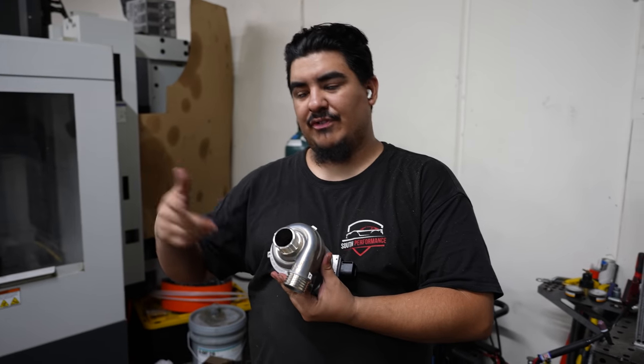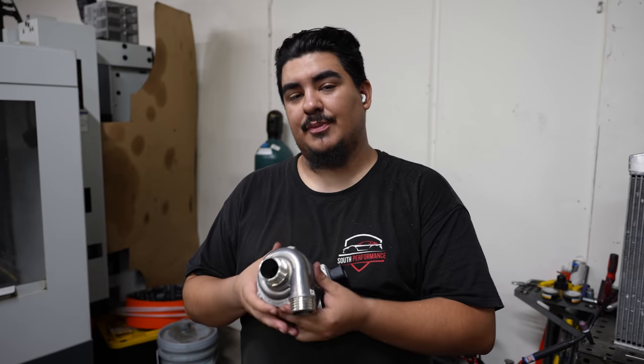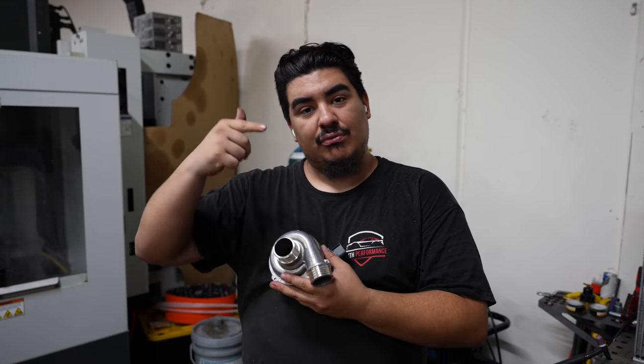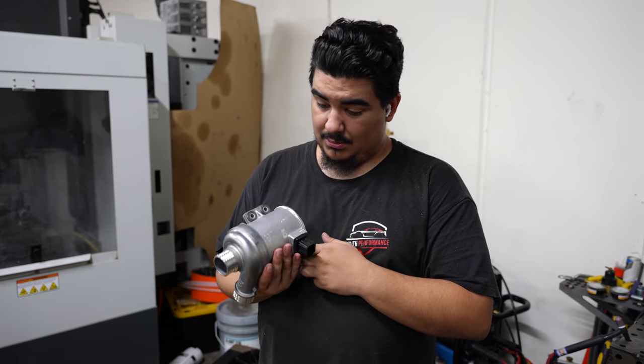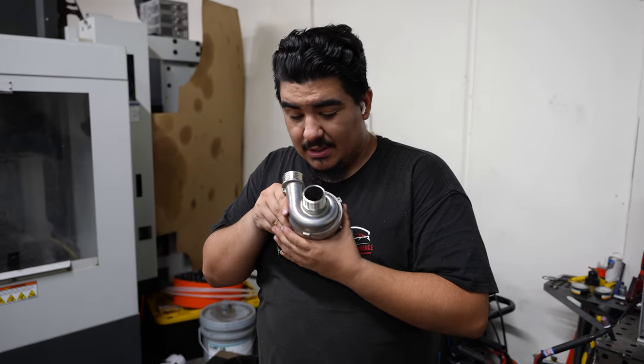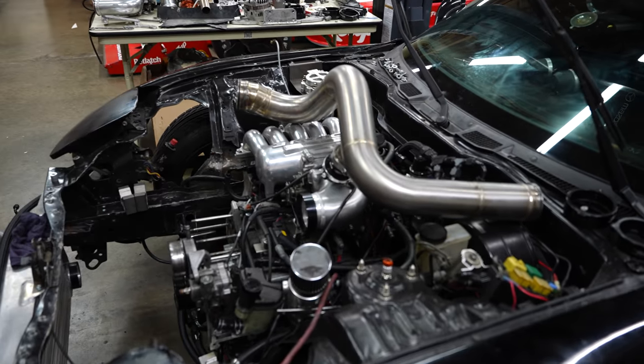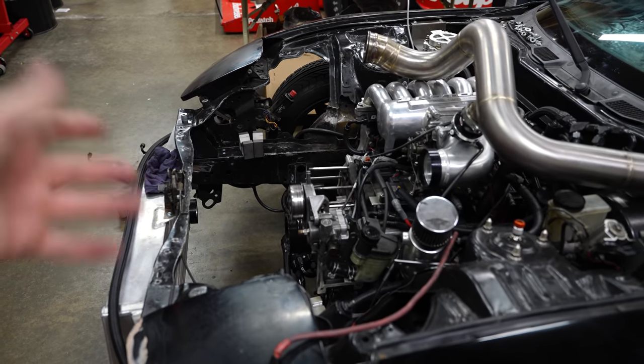The Mazda pump is driven by the belt — it goes fast because these things rev up fast, so you aerate your system, and that's a problem with them. With the electric pump you can literally just let it sit there and cool at whatever speed you want. You'll notice the radiator gets kind of hot when you're cooling down with the car off — it's not getting the heat out of the engine, it's just staying back there and the radiators up front can't cool down.